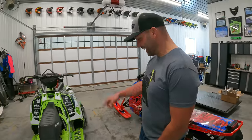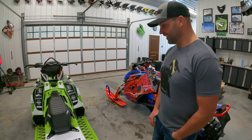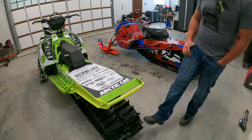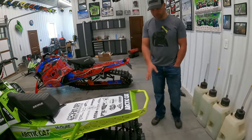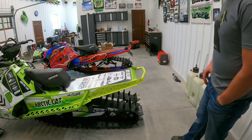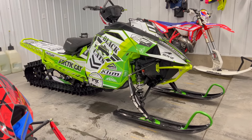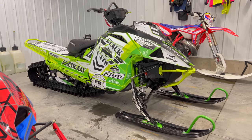There doesn't seem to be enough hours in the day — I still don't have my Skins running boards on; the other night I was putting them on until 2 in the morning on my turbo sled, so that'll come. Skins rear bumper as well. This is a 146 with a 2.6 track — a narrower pitch, the same track the hill climbers run. With these added fingers it's a really fun spring snow track, but Riley's been riding it November through January in deep snow and it's been fine.